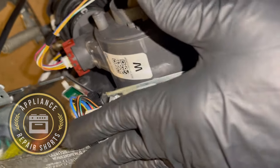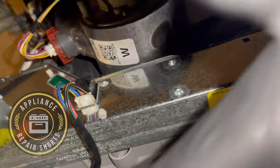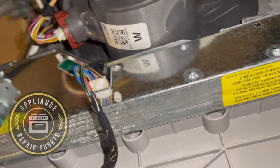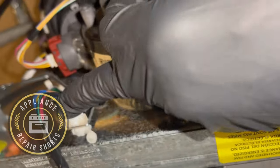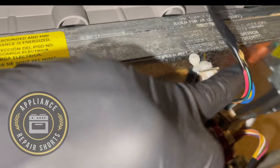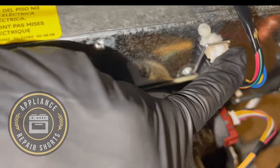I was on a job, very similar dishwasher, and that dishwasher had two issues. One, this controls your dishwasher up top. We just used the voltage tester. You can see, so this has power. A lot of times we don't know which wire has power. A lot of times when you're not getting any power to the display, you have to turn the breaker off, which basically I just did, and nothing happened. So the unit is still dead.